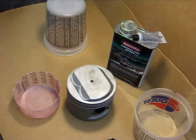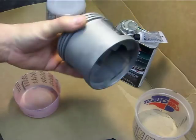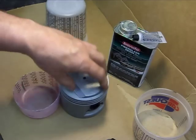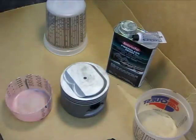What I'm going to do right now is make a resin casting of the top of this 1955 Buick Century piston. The reason I'm doing that is because I want to know the capacity or the volume of this dome. If you're buying aftermarket pistons, you want to be sure that what you're getting is the correct volume pistons so you have the right compression ratio.